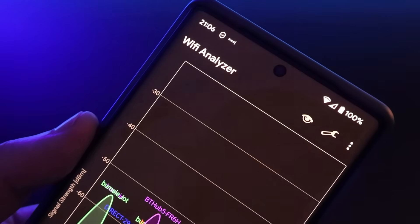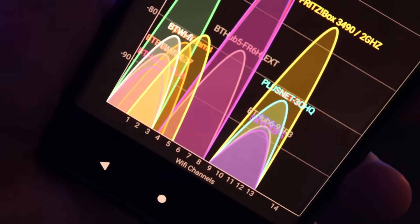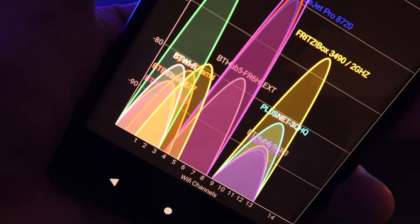Also be aware that if you live in a crowded city or an apartment building, your neighbor's Wi-Fi may also interfere with both your Wi-Fi and Zigbee networks. There are many Wi-Fi analyzer apps you can get on your smartphone that check all of the wireless networks in your area and tell you which channels are the most popular and which ones might be less crowded. If you have both a 2.4GHz and 5GHz Wi-Fi network in your home, then I suggest you connect as many devices to the 5GHz network as you can. Most new devices support 5GHz, and not only is it faster, but it also doesn't interfere with the Zigbee network. Sadly, older or cheaper Wi-Fi devices, like most Wi-Fi home automation equipment, don't yet support 5GHz.